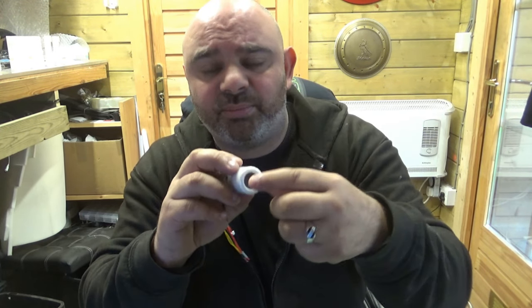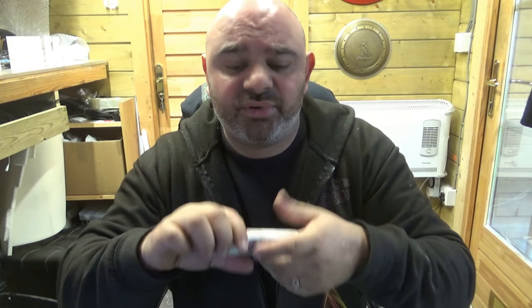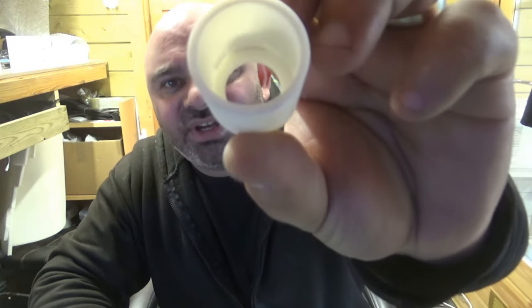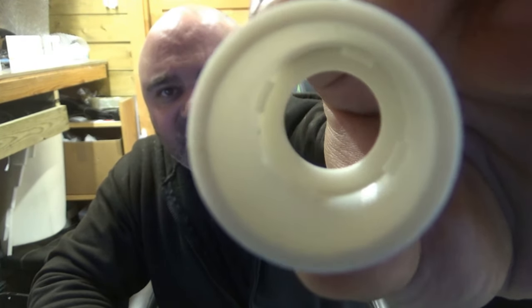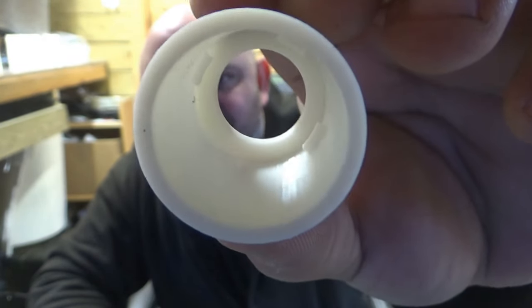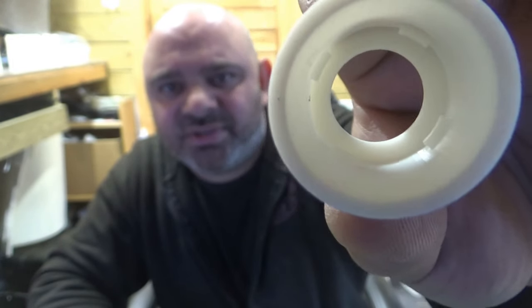Just as a note: don't ever use your finger to push the metal mesh to push your chassis back inside — always use a plastic piece to push the chassis in. Inside the housing you can see there are four feet. The metal mesh goes underneath these feet and is locked in place, and the speaker sits directly on top of these four feet, which means nothing is touching the speaker — it's completely free of any obstructions or issues.